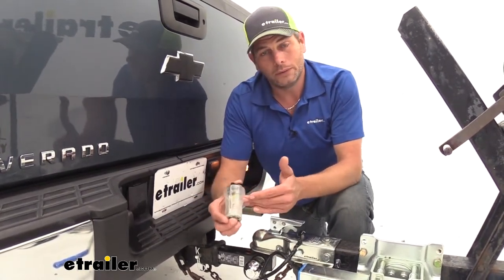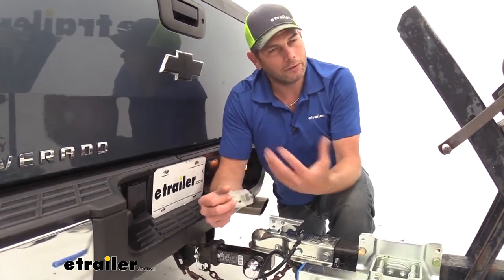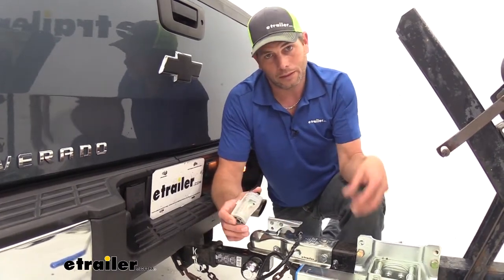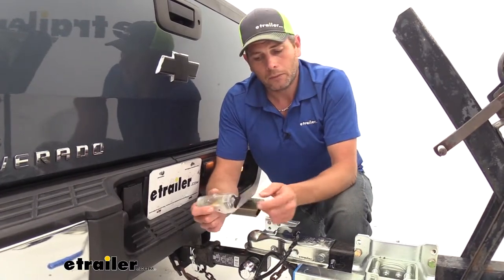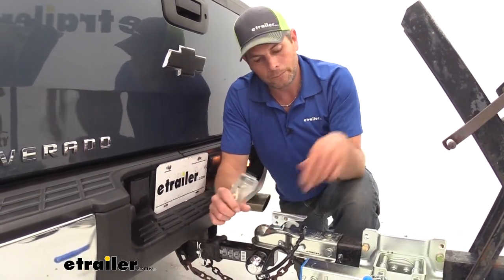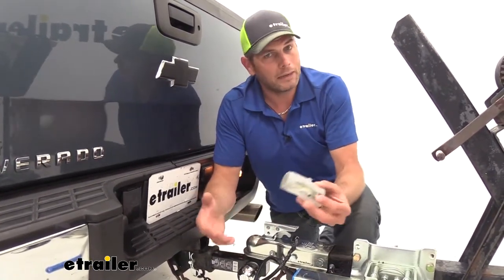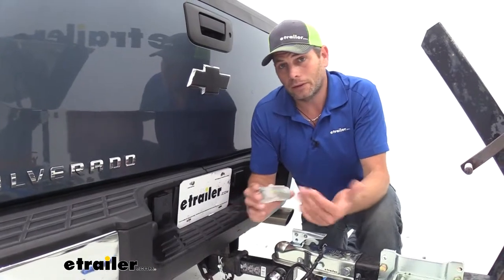Overall, if I was in the market for a 4-pole-only adapter, this would be an excellent choice. The one thing I'd have a little reservation about would be if I ever had any intent on hauling a marine trailer with a surge coupler with an electronic lockout, or if I wanted to put backup lights on my trailer. With a fifth pole, you get that reverse signal — so every time you hit reverse in the truck, it'll lock out that actuator for the marine coupler so you can back up without the brakes engaging, or if you need extra light behind your trailer as you're trying to park it.